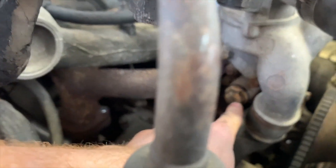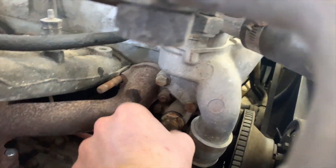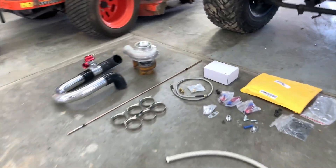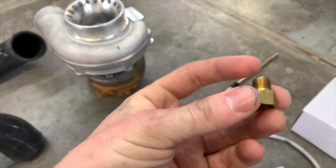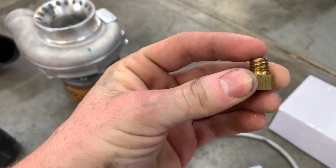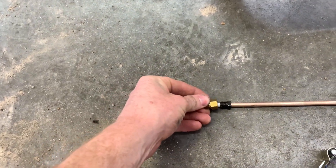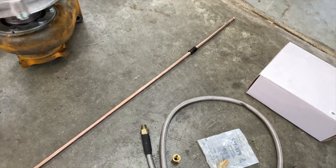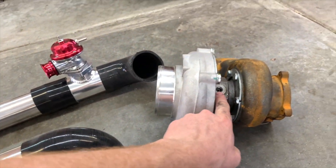So what I need to do — this spot right here on the motor I can drill and tap. I can take this bolt out, drill and tap it with this brass fitting that I have right here. This part will go into the bolt that I tap, and then this part will screw into there on the line, and then this part screws into the oil feed right here on the top of the turbocharger. So it's pretty straightforward. I just have to make sure I tap the bolt correctly and don't screw that up, so I have to take my time on that.